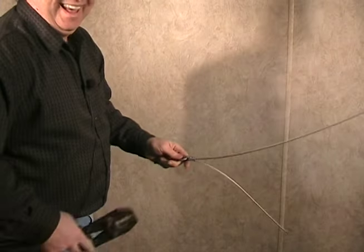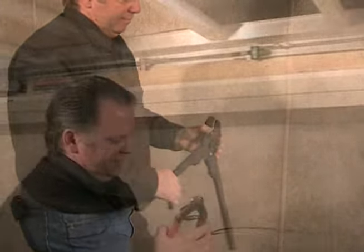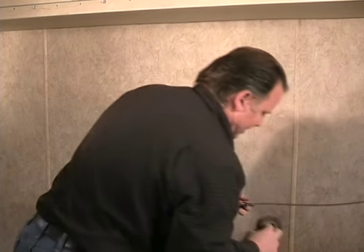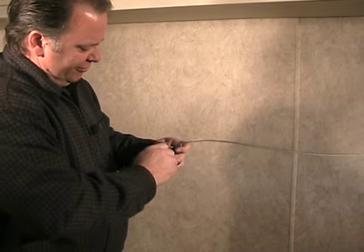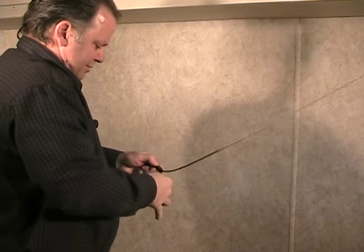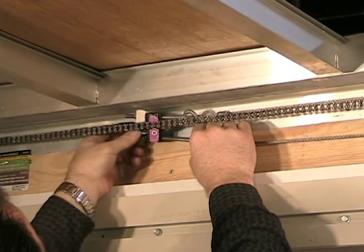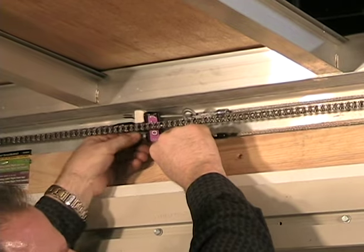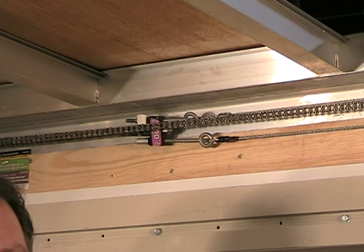If you drop the cable, go get it. Cut the excess cable off — make sure you cut off the correct side. Just for the sake of keeping your fingers from getting holes poked into them, tape off this section. Replace the stud into the bracket. At this point, you want to just basically snug it up to about finger tight, because before we complete this, we want to check and make sure the cable alignment is proper at the bracket so we don't destroy or damage the new cable.